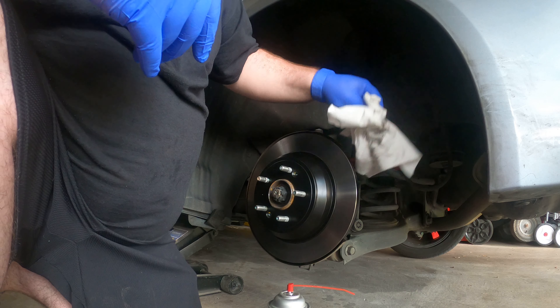All right guys, that's how it's supposed to be. The new pads didn't come with the little bracket pieces, so I'll steal them off the old caliper. I guess brake pad companies don't want to send you a fifty-cent piece of metal, so I'm going to pop them onto the new one and then put the pads in and start putting everything back together.